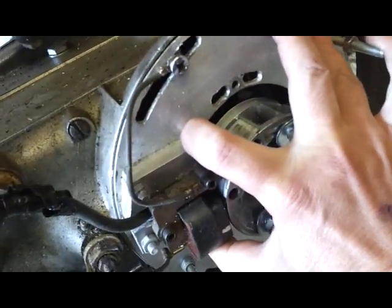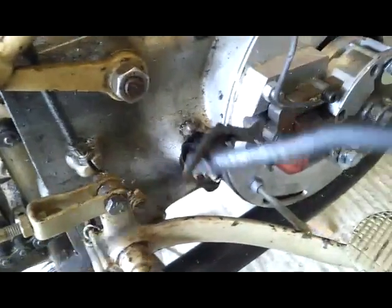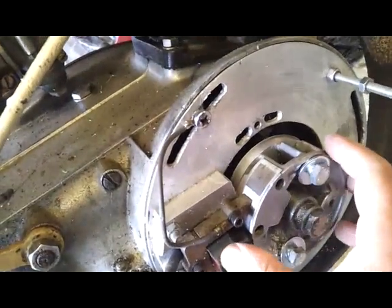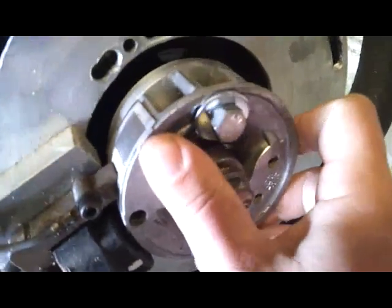So essentially you've got a magneto ignition with adjustable timing. I've just done a bit of a poor job extending the HT lead but it works absolutely fine. This bike hadn't run for about 15 to 20 years because all the old windings were ruined, but it started absolutely first time and now it runs absolutely fine.